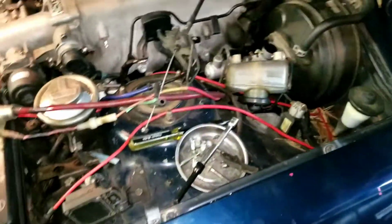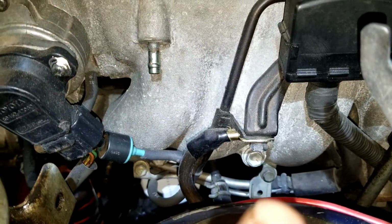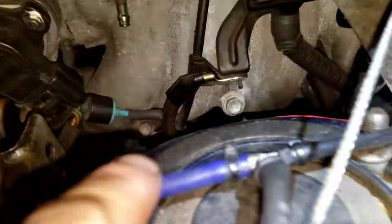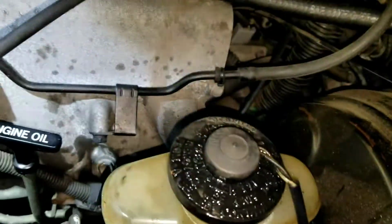Oh, great. Okay. So, to go about taking this off some more, you've got some bolts. There's one right there. There's 12mm bolts. I'm not sure how many there are yet. I believe you have to undo your oil dipstick and pull it out of the tube down there. There's also a mounting bolt down there for it as well. So systematically just take your nuts and bolts off, and then your intake should come off with a little brute force and ignorance, you could say. So hopefully that'll work.